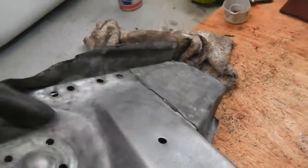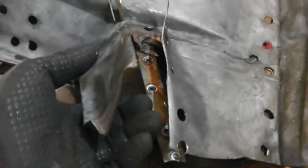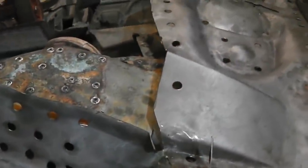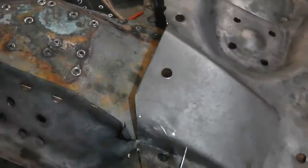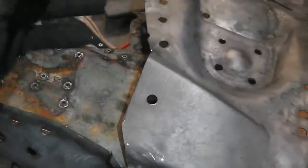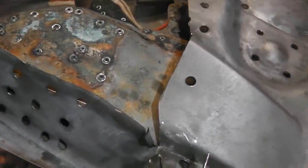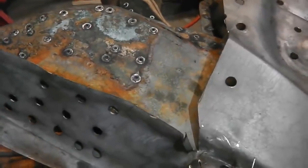Let's do this. Oh yeah. Join me then on the floor for the last piece of weld holding this together. Now, to make life easy, because we have mentioned this little tip in the past, where if you don't need the panel you're removing, don't worry about slicing it, to give you easier access for rocking your spot welds off, because they won't always break, as you know.